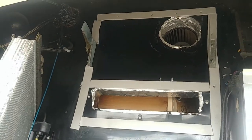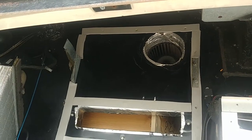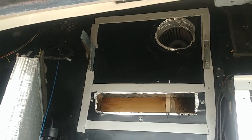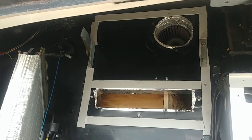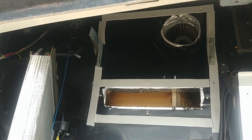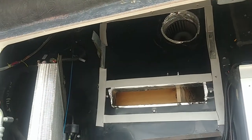I'm going to put a filter right there on the inside so it doesn't collect any more hair or debris. Basically it was blocked up there where that fan is — it was blocked on the front of the coil by hair. On hindsight, now knowing how brittle this shroud is right here, I would probably just get somebody with small hands.